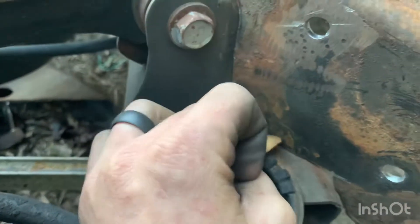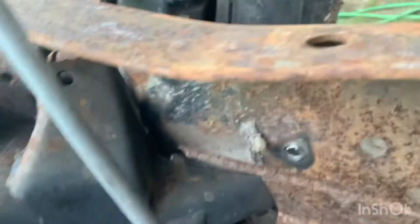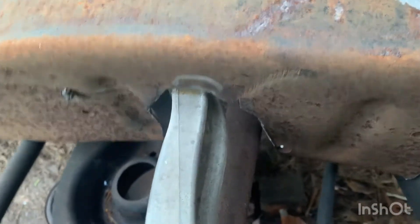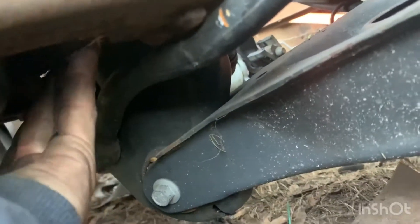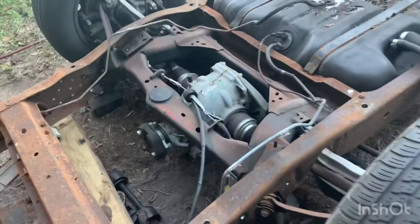I've got really good tolerances on both sides so the whole tower will get welded straight to the frame. I've got a nice smooth edge all the way around — I cleaned it up a bit with a little more touch-up to do. I actually got the little horns that I cut off to tuck all the way up into the frame, so I can weld them on the bottom, top, and side. I'll have to build some sort of brace to go from here to here, but overall it worked out great.